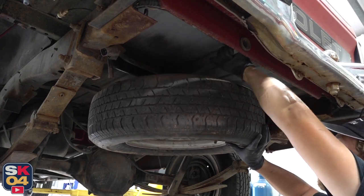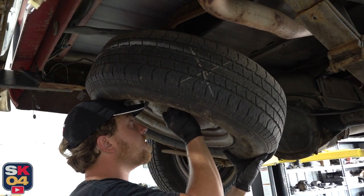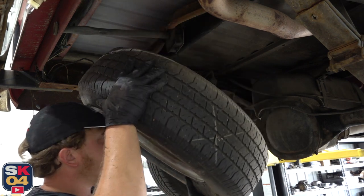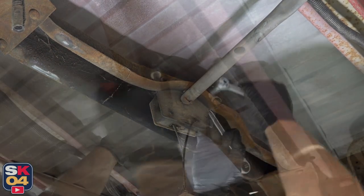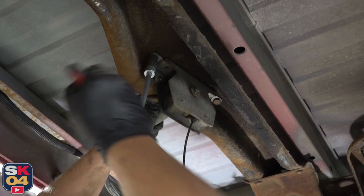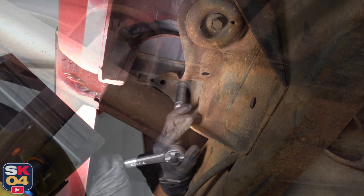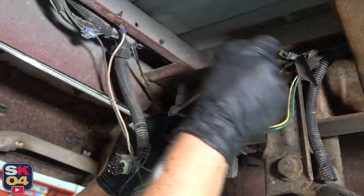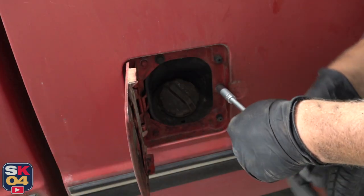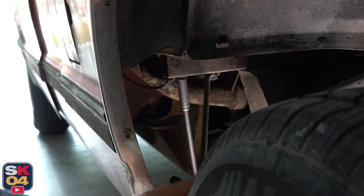With all of the wires out of the way, I'm going to go ahead and drop the spare tire. The hoist assembly is mounted to the cross member that spans the frame rails, but the handle that you twist back and forth to lower or raise the tire assembly sticks through the bed at the back. There's a little plastic grommet that prevents it from flopping around. By dropping this whole assembly, I can also give it a thorough cleaning and lube everything up inside so it operates nice and smoothly. The bed is held to the frame by six bolts — two at the front right behind the cab, two right behind the shock absorbers, and two at the rear of the frame. The last two things I have to do before the bed can come off is undo a couple bolts that hold the fuel filler neck to the side of the bed, and undo the ground strap underneath.